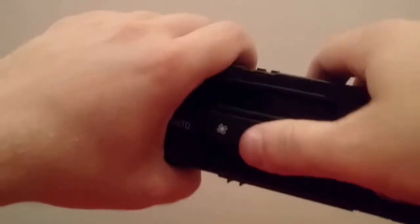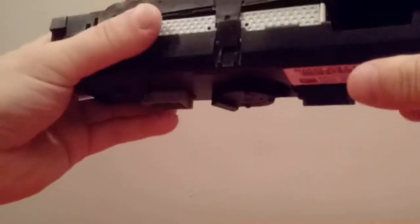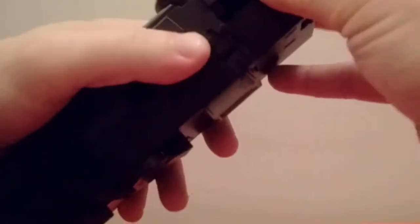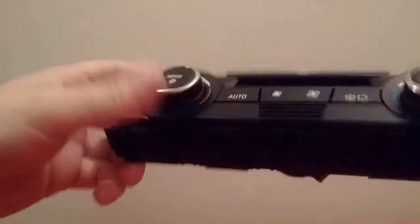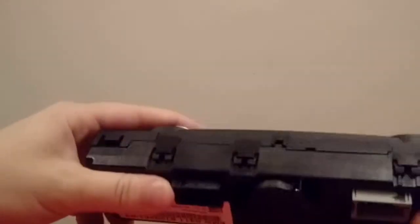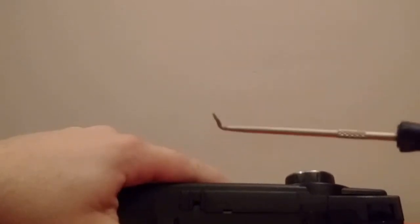I just want to show another demonstration. Any time you'd instinctively use a flat head or something like that to accomplish a task, consider this tool seriously. For tabs like this, for clips, like wire connectors and harnesses that have tabs that are hard to push in to get everything to release — use this tool. For example, I replaced the dashboard in my car and I had to take the airbags out, and the connector clips for the wiring for the airbags are very weird to deal with, and this thing worked amazing. In fact, that's how I discovered what to do with this tool.